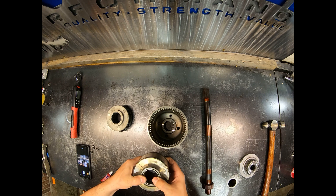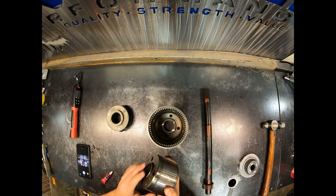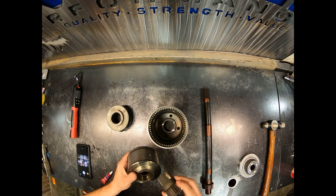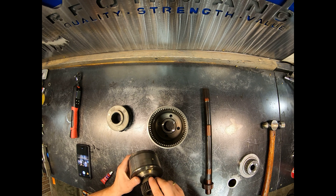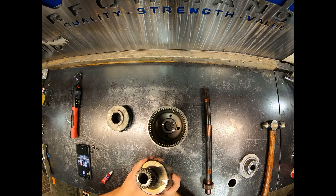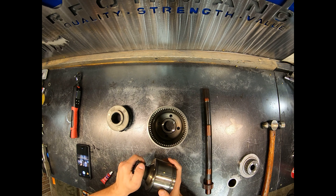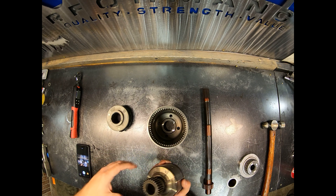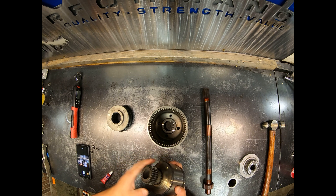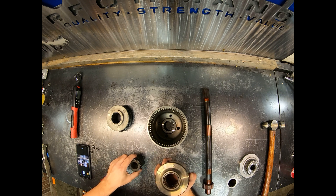Additionally, you should be able to grip the centerpiece and not move it. If you can move it up and down, that means the o-rings in here are bad and the viscous coupling unit is no longer functioning. You can also put your sun gear in here and attempt to turn it, or put this in a vise and use tooling to get the exact rotational torque measurement — you're looking for about 20 foot-pounds once it gets going. But if you can't turn this by hand at all, most likely the unit is good. That's a quick check you can do.